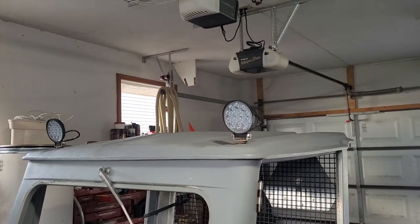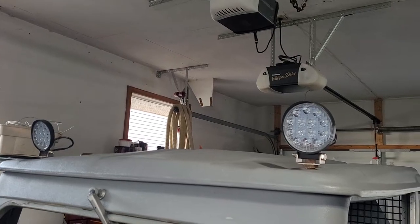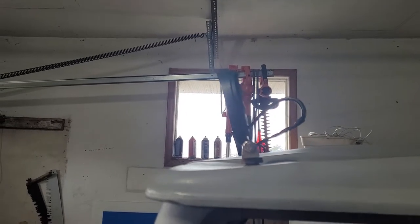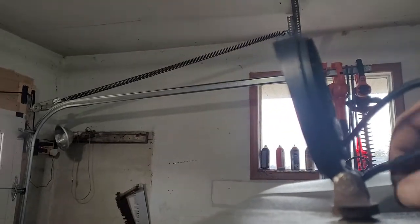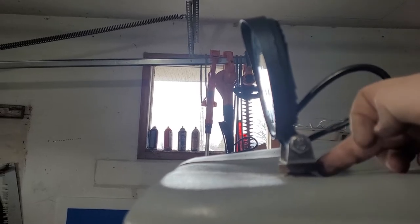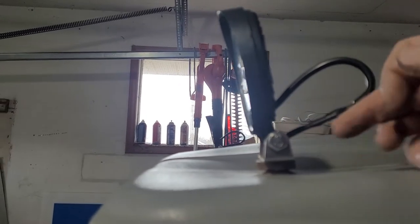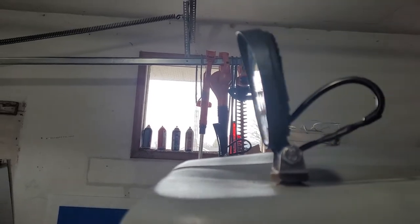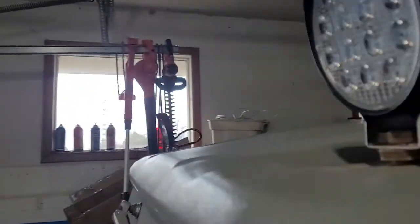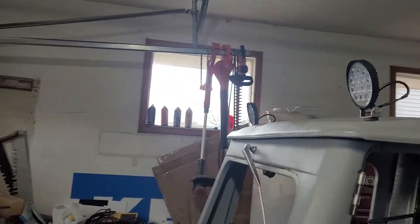I have finally got the rooftop lights on. These are actually the same rooftop lights that I used on the parts cart when I got rid of that. I bought two sets of them. They're not terrible - they're all plastic. They didn't come with any relay switches or anything, basically just the light and a short pigtail. Up here is my existing wiring. All I really did was I removed the original mounts because the mounts were incompatible. I left the original bolt because the bolt actually has the hole going through it to run the wires through, so I left all the mounting hardware the same except for the mounting hardware for the light itself. I used a stepper bit and drilled out this bracket here. With a little bit of work, they were relatively easy to install.